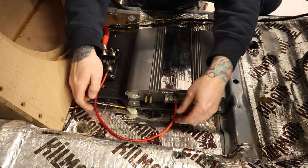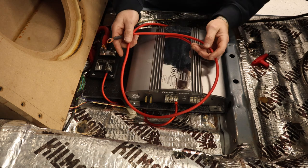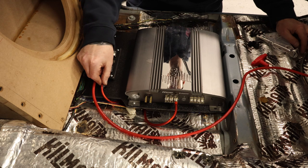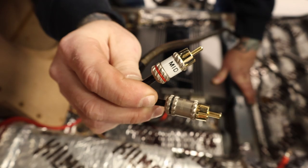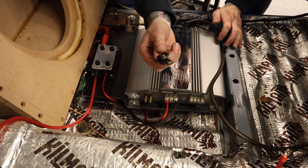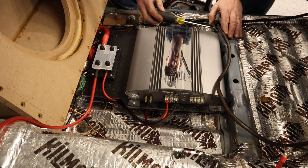Well that's crispy — this just doesn't make any sense. Here's the power wire for the sub-amp: 1/0 Colossal Cable coming in, 8-gauge going over to the sub-amp, 10-gauge feeding the mids and highs. I marked out the RCA so I could tell them apart — these obviously go to the mid-range amp. I'm going to use some cushion clamps to hold these in place, but I'm looking for a better option.